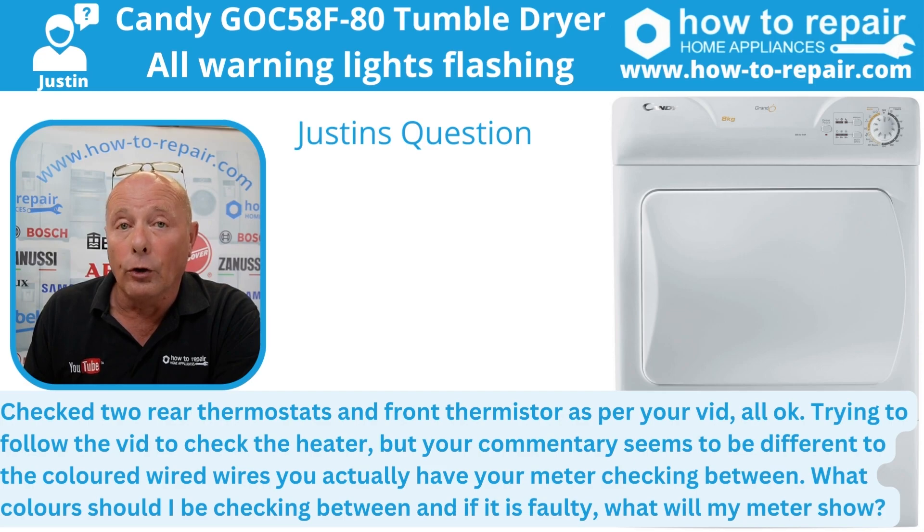You're going to need to check all the thermostats, the NTC sensor, the heating element, and also the relays on the circuit board. There are a couple of relays and one of those relays is there to activate and deactivate the heating system as required as the thermostats and NTC sensors reach the correct temperature — this is called cycling. If you have an error with any of the circuit, it will come up with flashing lights. Your model doesn't have a digital display, but the flashing light sequence may be indicating what the error code is, and we'll go through the whole circuit diagram now.